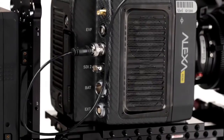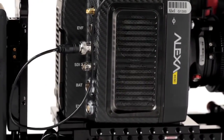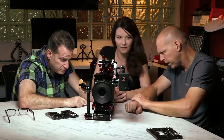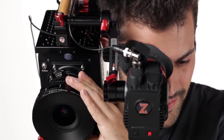In the back top there's timecode — configurable as in or out in the camera. That will make a nice little multicam setup. There's also an ETH port — a LEMO to ethernet connector that you can use to log in online. ARRI uses it for service, but you can also control the camera through that.